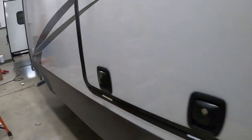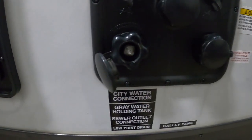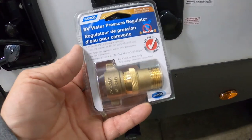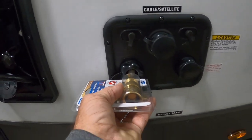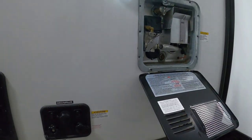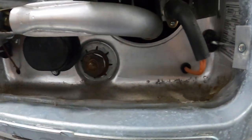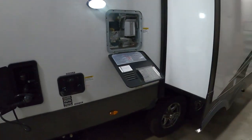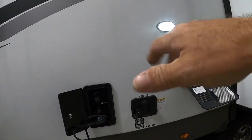Alright, power is hooked up — let's hook up our water. At campsites we hook up to the city water connection. First and foremost, use a water pressure regulator. This regulator reduces water pressure to 40 to 50 PSI, protecting the lines in your unit — always use this when hooking up water. Hook up your water pressure regulator and hose but don't turn that hose on yet. Find your hot water heater and make sure the drain plug is back in there. Put some plumber's tape around it — not putty, as putty will gum up on you. Get it in there nice and snug, then turn the water on. Go inside, open the slides if needed, then open up all your water taps to get a steady flow through your sinks and showers, then shut them off and you're all set.